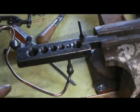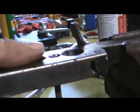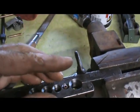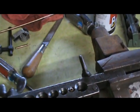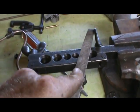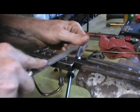I've got my brake line fastened down here, tightened my wing nuts, and I've left it sticking up just a little bit. When you cut that line with your tubing cutter, it's going to be rounded over on top — just a little bit. We want that flat, so I went in and chucked it up here and I'm going to file that completely flat.